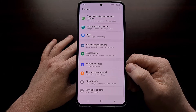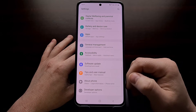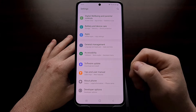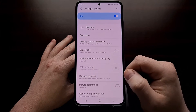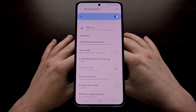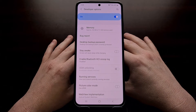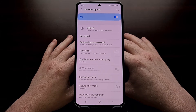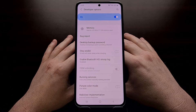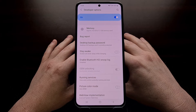If you're done with it and you want to go back to complete 100% stock, I've recently shown you how to return to the stock firmware. If you have ever modified your device in the past and you wish to lock the bootloader again, I highly recommend that you make sure you flash the 100% original firmware using Odin, because if you lock the bootloader while having modified files on your device it could result in a boot loop or a bricked device. It's certainly not recommended to lock the bootloader when you have unofficial signed software on your device.